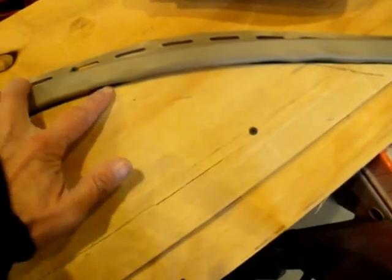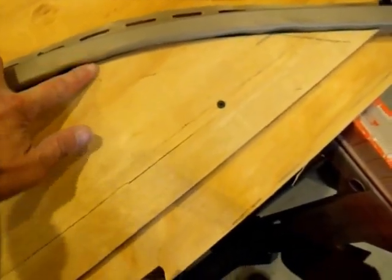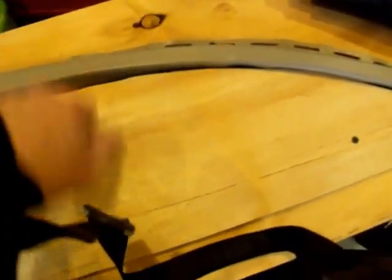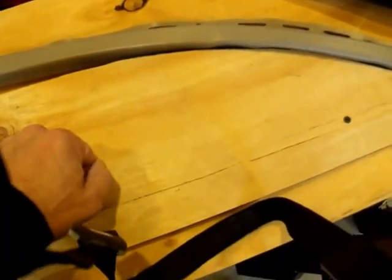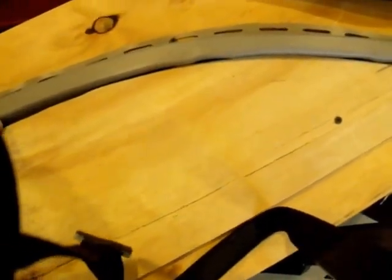You can see here there's a little gap and this isn't smooth. That usually happens when you get too much heat on the inside flange — that's the main problem. And if you try to pull the J channel instead of just twisting it into place. I'll show you a little bit about that in just a moment.